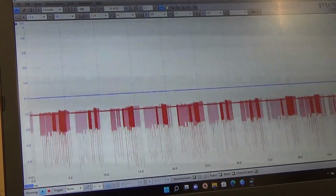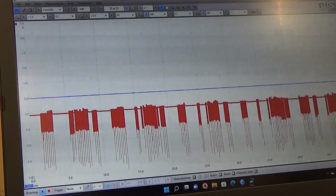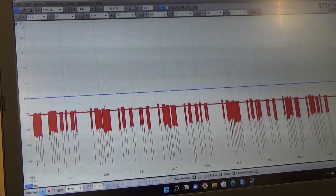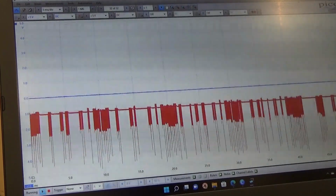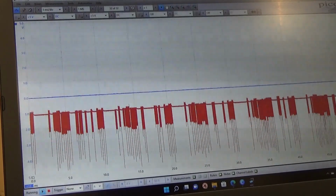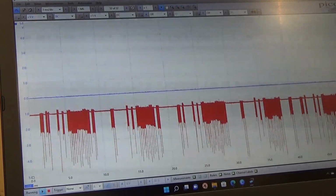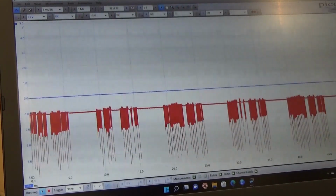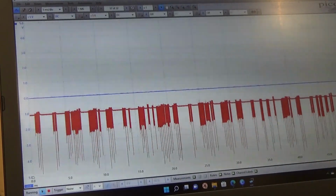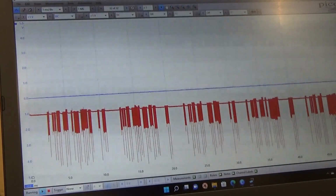So I'm gonna go through that wiring diagram with you, and then for this active air flap, I think I cannot access it just from the front bumper. I have to lift up the vehicle and then we'll try to remove that connector, just to double check whether it's the active air flap causing this issue. Let's see, when we remove it, if the active air flap itself is contributing to this issue, not communicating to the ECU, because earlier we communicated no problem, right?